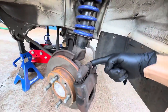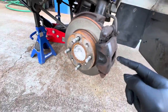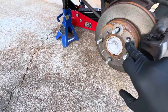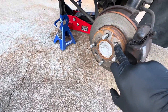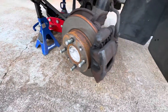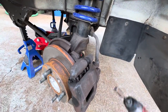The next step is to pull the slider bolts, and they're here. Your brake pads are right here and this is your rotor — it's a good time to change it as well. It looks like whoever changed these pulled the alignment bolts — the tapered bolts — and didn't put new ones in. That's a no-no. So we're going to pull these alignment pins next.